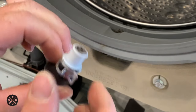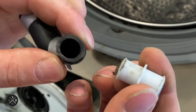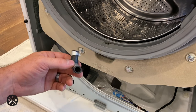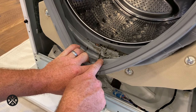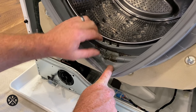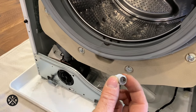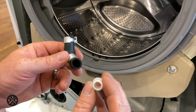This end right here is clear, but you can slide it down and check it. It's completely clear — can't really see through there — but this here is the plugged part. Look how nasty that is. I would recommend taking the time to check this out while you're at it and make sure yours isn't plugged. If you are having this issue with it being plugged and not draining properly, that seems to be the problem here. I want to replace the door seal because it's been moldy so long there's no way to actually clean it. Every so often you could run something flexible and gentle through there to make sure that's clean, because once it gets down past the neck, the hose is bigger and it's not a problem.